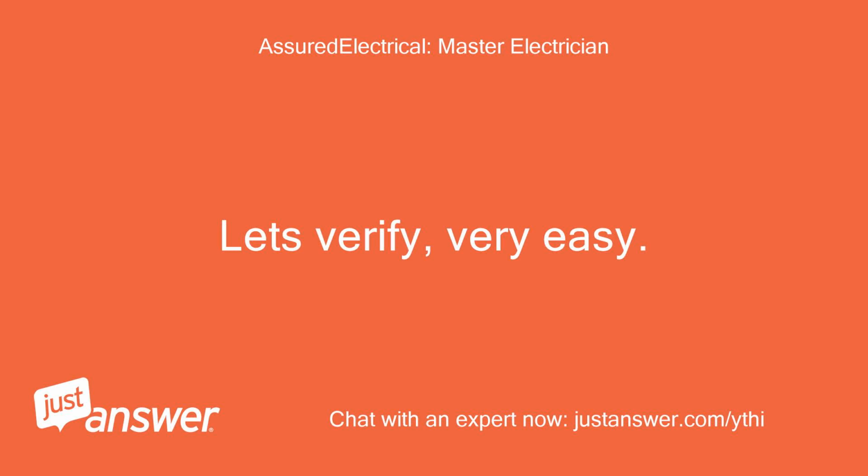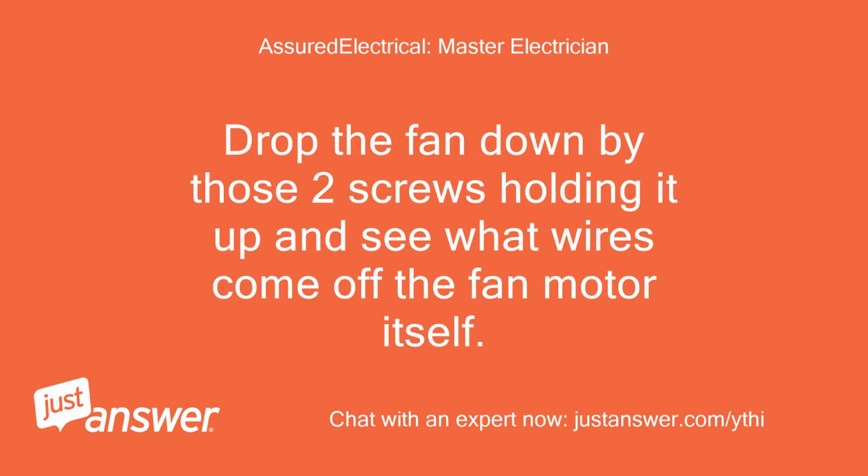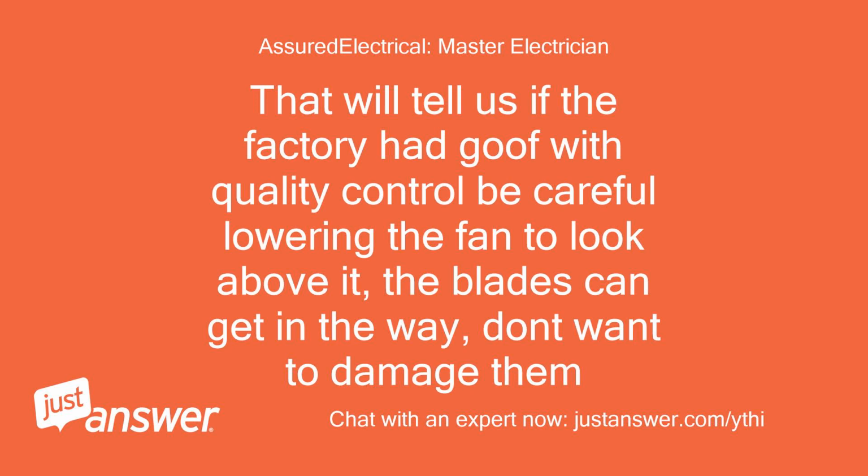Let's verify, very easy. Drop the fan down by those 2 screws holding it up and see what wires come off the fan motor itself. That will tell us if the factory had a goof with quality control. Be careful lowering the fan to look above it, the blades can get in the way, don't want to damage them.